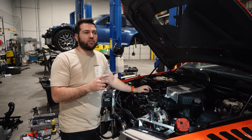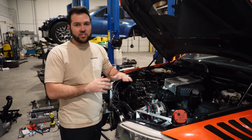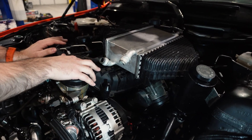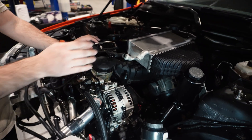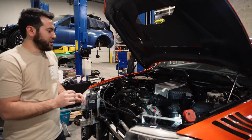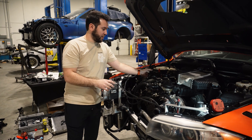When I was looking at the F80, I thought I'd seen that intake manifold before — and sure enough, it's literally the same part number as the N54 manifold. So this intercooler mounts right on the nubs of the N54 intake manifold, meaning the throttle body stays in the stock location. Then I realized: if that's the same, the J-pipe to the intercooler has to be the same too — and sure enough, it is. So obviously the charge pipes are different.